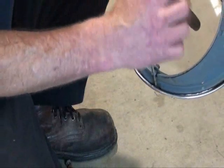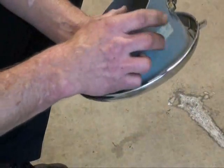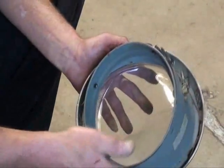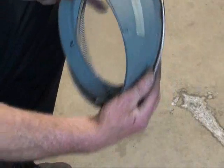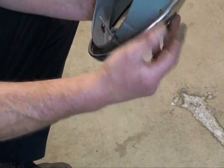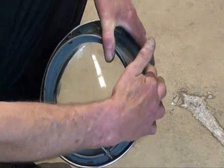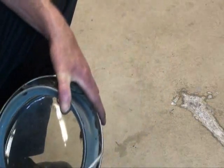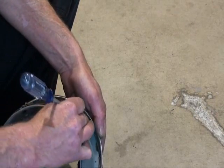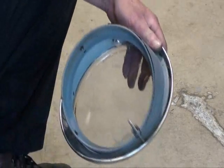The inner bucket here is attached with the two pivots, side to side, and the adjusting screws to another outer ring, which is what is attached to the chrome. Your front glass is sandwiched in between those two pieces, and it's held on by a bunch of the same type of spring clips. I noticed one here has popped off the lip and not really doing anything. So I was going to go ahead and put it back where it belongs while I'm in here.